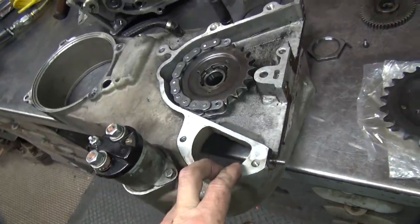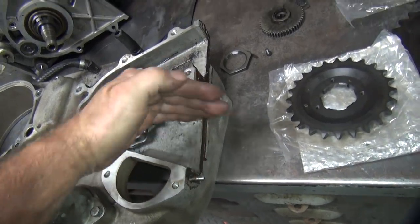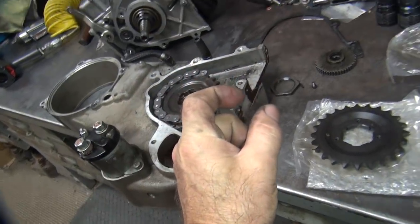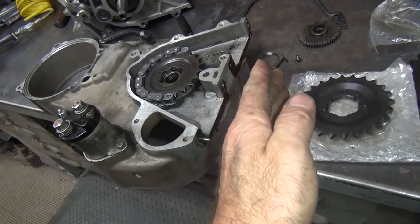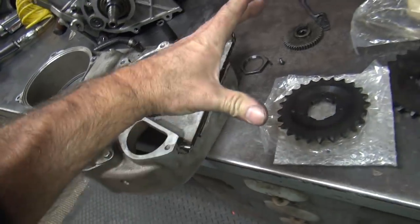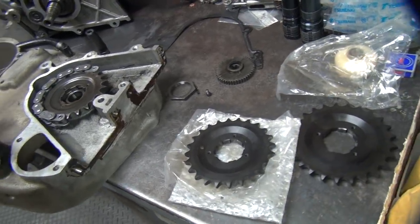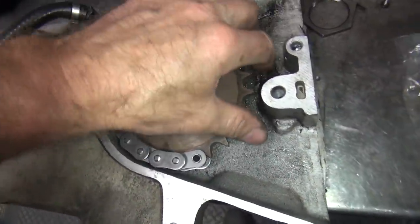I would say go to 23 and figure out what you've got in your back wheel and drop some in the back. I know this is pretty tall but I don't know how much you can put the chain up on this side. The FXR has that big heavy offset sprocket in the back. So if you run an adapter plate on there and then run the normal dish sprocket, V-Twin has a 43 tooth steel I have in stock — that would drop your diameter way down. But we've got to see what stock is for your bike. So we'll go do some more investigating. I went and found a 23 tooth sprocket — put the chain on it, shove it all the way until it hits.